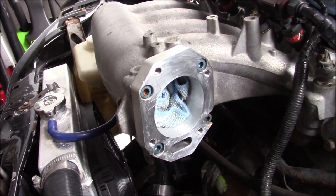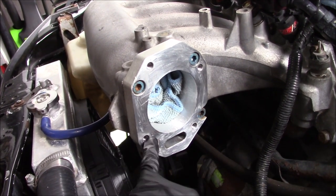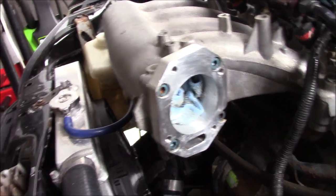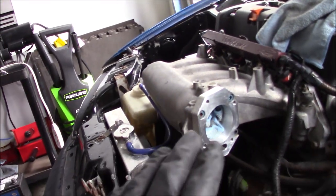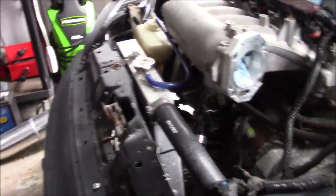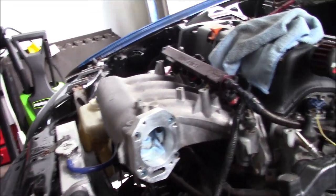So this is all cleaned up. I have a rag in there because there was RTV coming out everywhere. I cleaned up the bolt holes right here for the throttle body because they had some RTV in them. All I did was pull out my re-threader kit, re-threaded the holes, cleaned them all up, sprayed the inside with brake clean, and then used a small air compressor to blow all the rest out. So these are good.